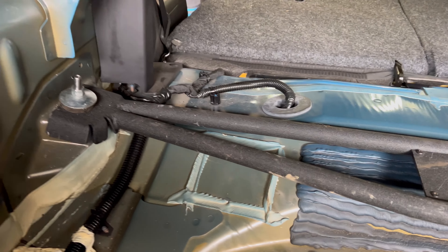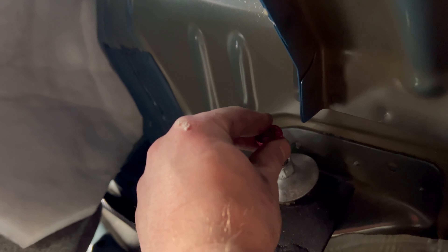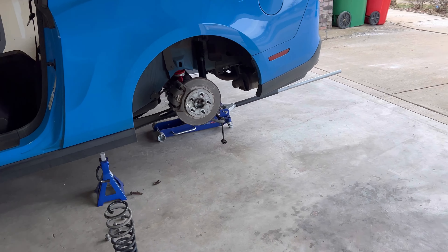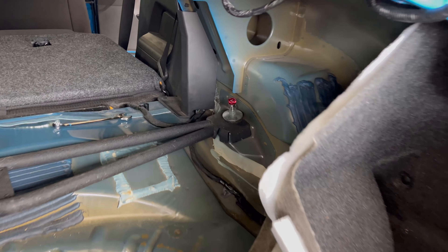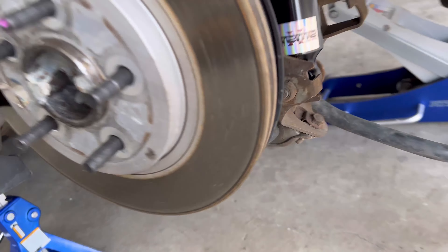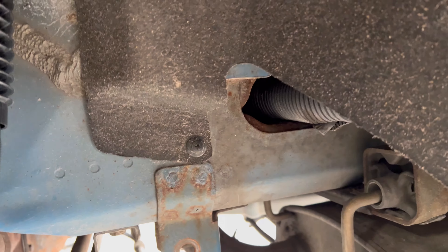I took the time to put in this strut tower bar in the rear, simply because once I get them secured, I am never taking them off. Don't forget your caps for your rear struts so that way you can adjust them — they just pop right in there and get hand tightened. So everything is in. Your struts are in. I'm going to drop it down, put everything back up, hand tighten it, throw the wheels on, and then we are good to start dialing everything in. Don't forget these get tightened and the sway bar must go back. Pretty simple on the rears.